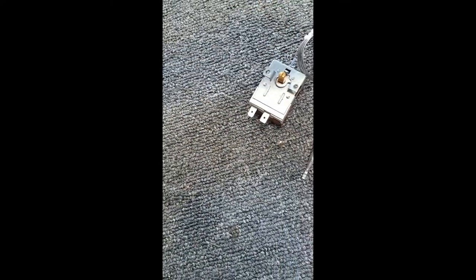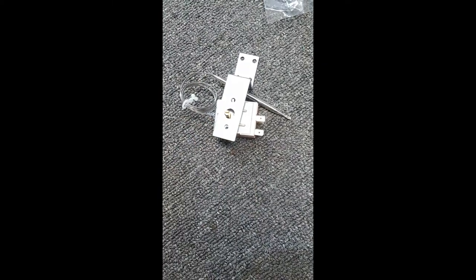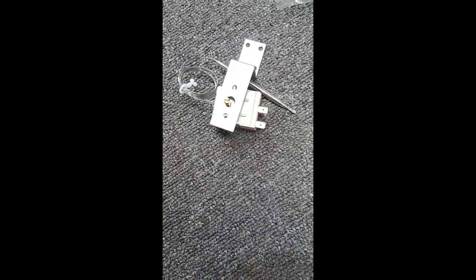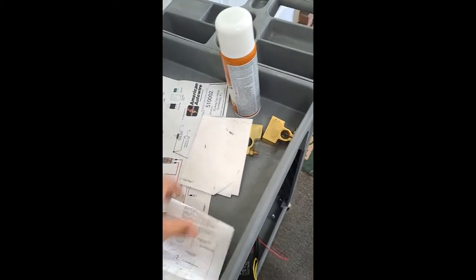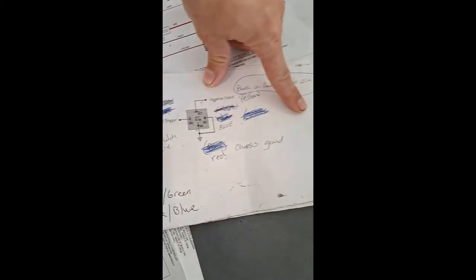And then I had it like this, hanging downward in my Jeep, and this ran up to where I needed to, the radiator, and the wire just came out this side, grounds, and they complete a circuit, and it puts power to the fan. Just on the ground side is how it completes the circuit on this particular Jeep model. Oh, and here's that diagram he drew me up for the AC thing.